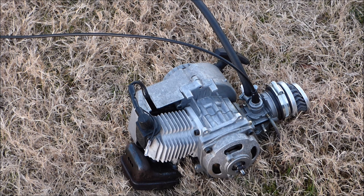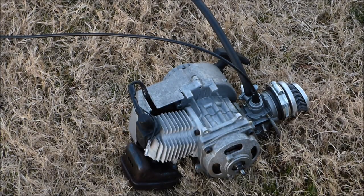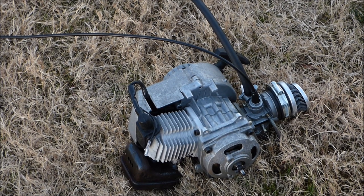I haven't hooked it up to anything yet, but at least as far as I've tested it, it works well. Now the pull start on a couple of these did break on me, so be aware of that. I think as long as you treat it right and you're starting it gently, it should work okay for you. This particular engine did come with a third bearing support for the sprocket, but I took it off for this video. I am starting this engine warmed up because it has been running a few times in the past 30 minutes, but when I cold started earlier, it started pretty easily with just a couple of tries — especially when you have your air lever in the right spot.